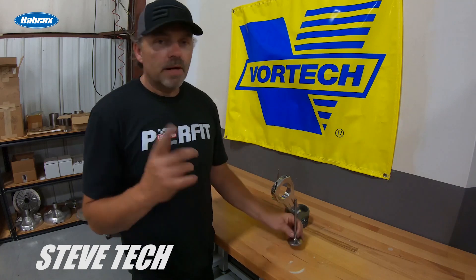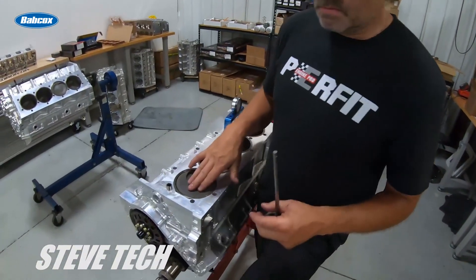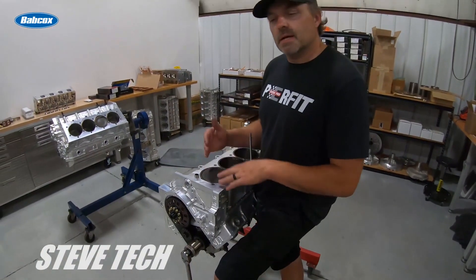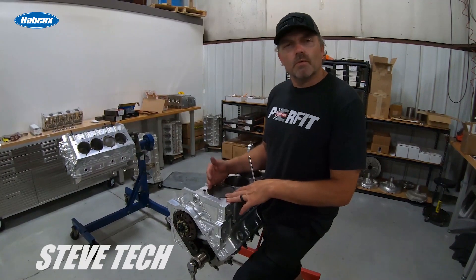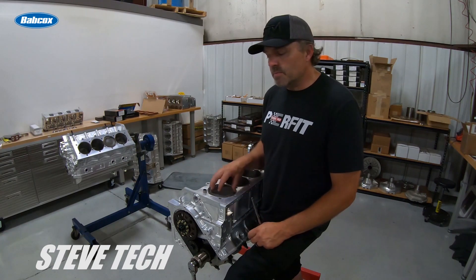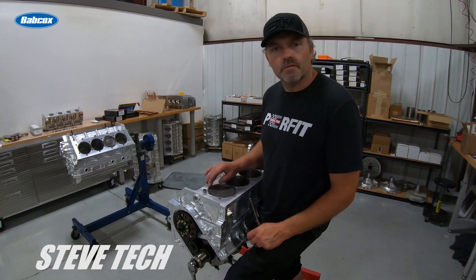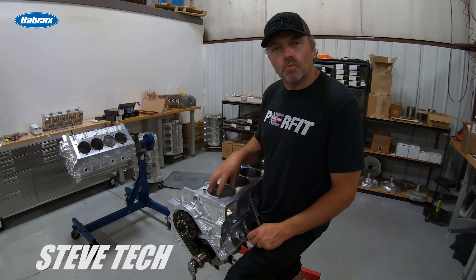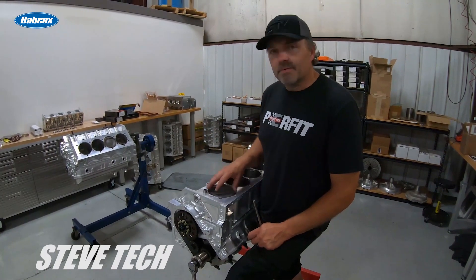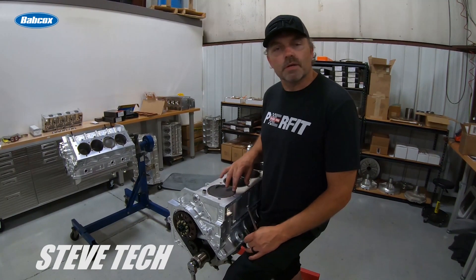Go back over here — this SMX motor has the piston 50 thousandths in the hole. We talked about piston design and decks in another video: in the perfect world, this clearance would be absolute — the piston would just come up and keep the carbon clean off the cylinder head area, it would actually touch the cylinder head. That would be absolutely perfect, and that's what we talked about on the quench video.